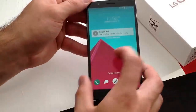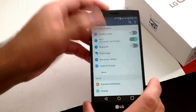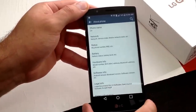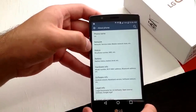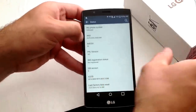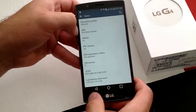So go ahead and check it on the phone. The way to do that is go into Settings. Once you are in Settings, scroll all the way down. At the very bottom, second to last, you will see About Phone. The third one down says Status — that's the one we will need. And the second one down here is your IMEI. You can just go ahead and double-check and verify with the box, make sure it's the same one. This is the same one.